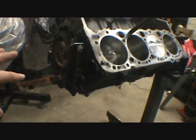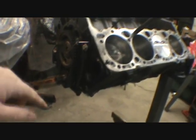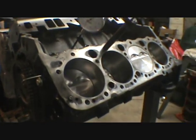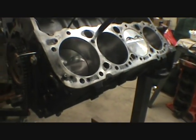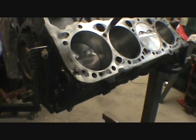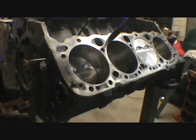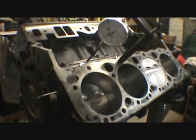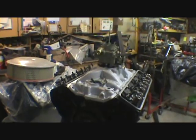So now that that's degreed in, I can get the box down, torque the rods, put the heads on. Well, actually I gotta start washing parts. I gotta wash bolts and push rods, and oh yeah, the push rod length checked out too. So where we can put this thing together. So alrighty. Oh, there's a sneak peek of what it's going to look like.